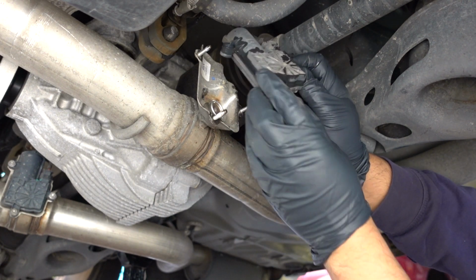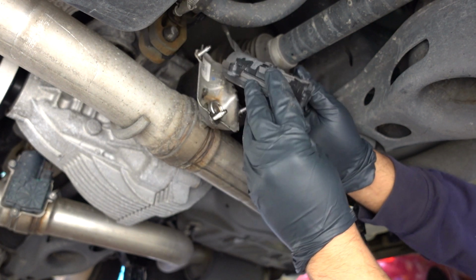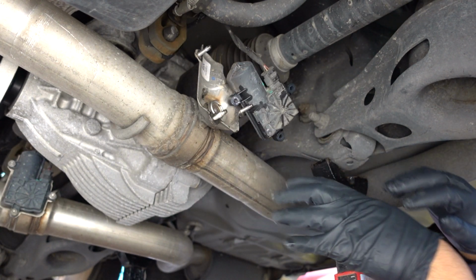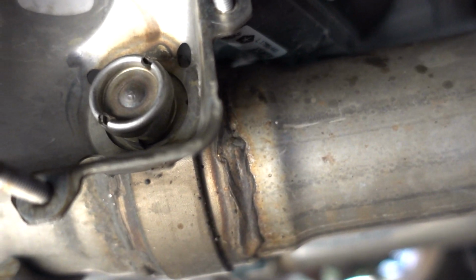And these are where these belong. So I think we just ran across a small fluke. Got two little pits on either side of here. Let me get you guys up a little bit closer. So you got two little pits on either side of here, match up into the spring. And apparently the spring is, well, it's still good. But I'm going to match the spring back to this position here, so we make sure this is working like it's supposed to, and then we'll seal this back up and drive it.